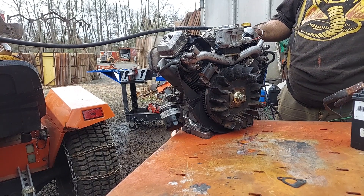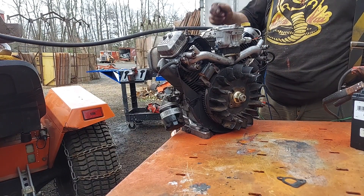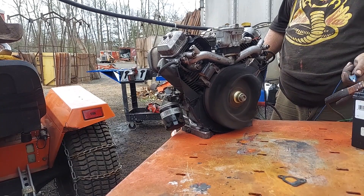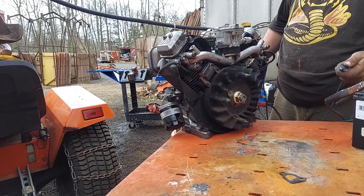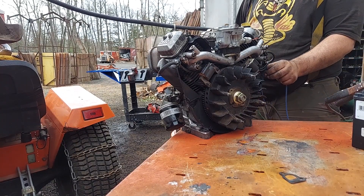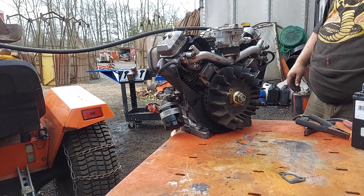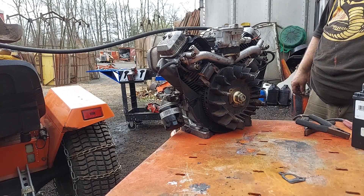That's the solenoid shutoff — by taking power away it kills the fuel supply. This is grounding out your coils. That's how these shut off both ways. And then our video that shows you how to take it out will show you how to put it back in. But as far as this part goes — your carburetor or your coils — whatever video you're looking at.